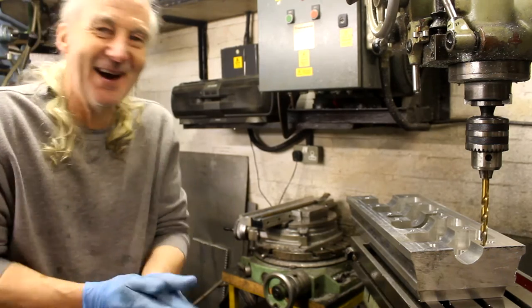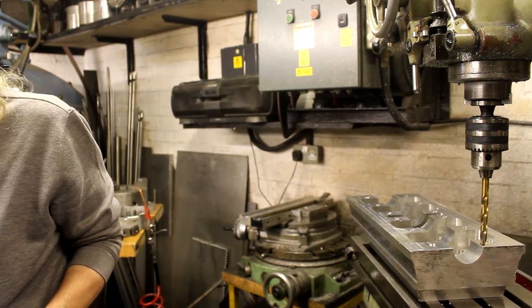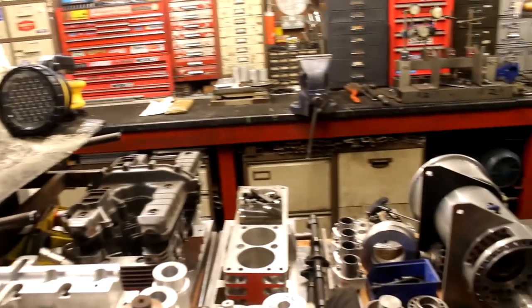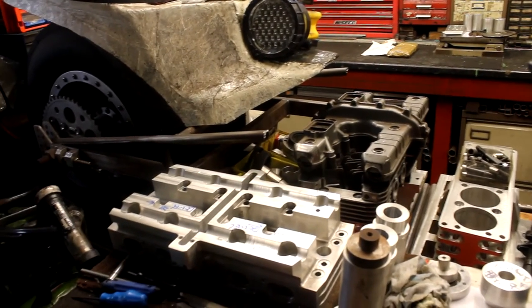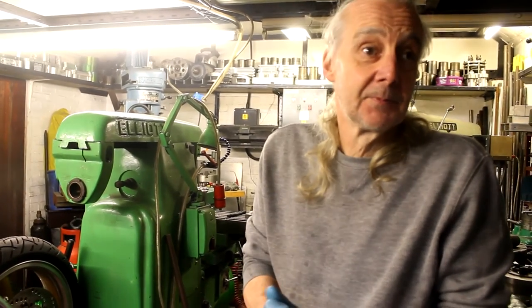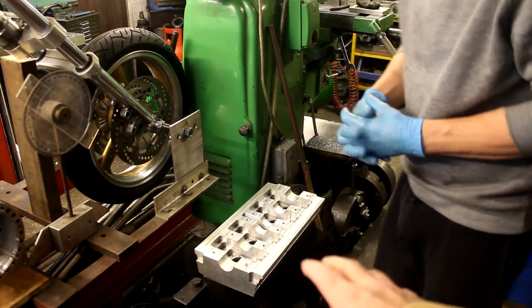Next to me and down here we've got another case - they're having modifications. Let me spin around and look at that. Down here Jeff you've got another crankcase. What's this one for then? This is our bike - this is the top fuel bike and it's all in bits to save space. And there's the head - that's a zephyr head that's been modified. The casting on them is vastly superior to the standard deals, with bigger valves - the valves are about two mil bigger on each.